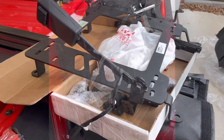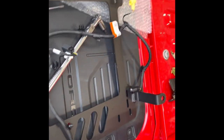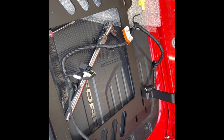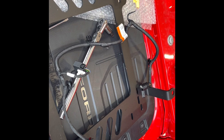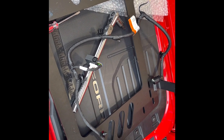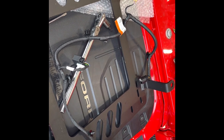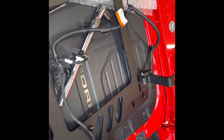On the passenger side, you're going to have three plugs basically. One of those is for the airbag, one of those is for the seat sensor, and one of those is for the seat belt. We will have the airbag light pretty consistently, which is not a big deal — it's a little tiny light, kind of like a seat belt light almost. But the seat belt light won't be on, which will be the nicest thing about moving the harness into the bracket.